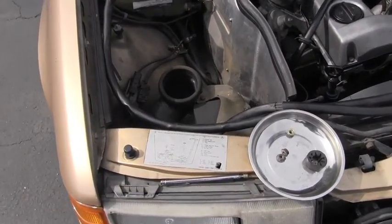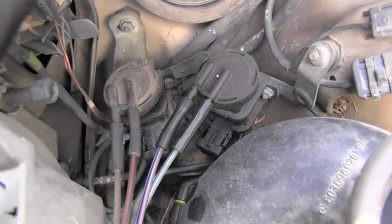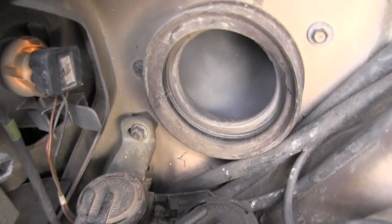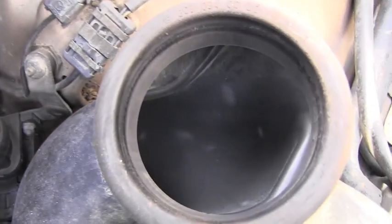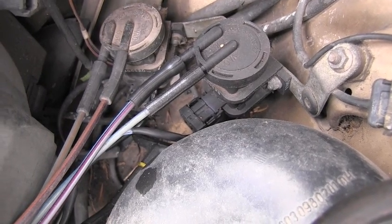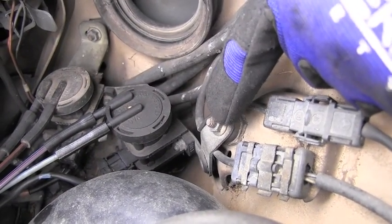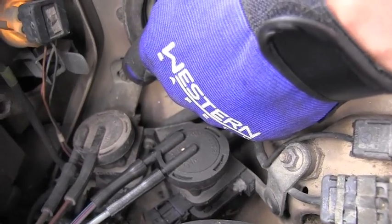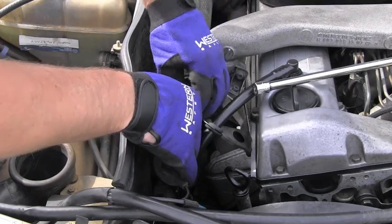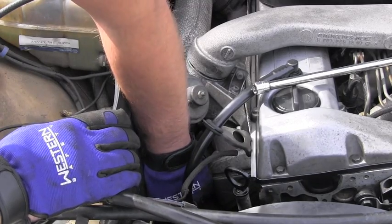That's awesome. I'm sure you want to have a look inside before I remove all that. So this is the way it's organized here. You can see the air intake and the outlet going towards the turbo. Now I will disconnect two electric connectors to the vacuum transducers and undo these two 10 millimeter nuts which are holding the entire bracket. My next step is unhooking vacuum lines from the EGR valve and also down there the air recirculation valve.